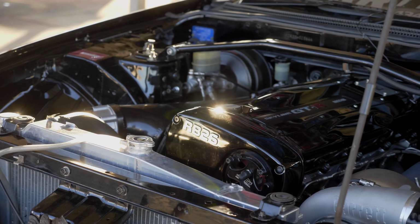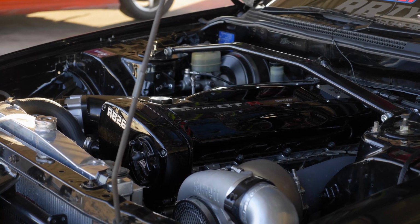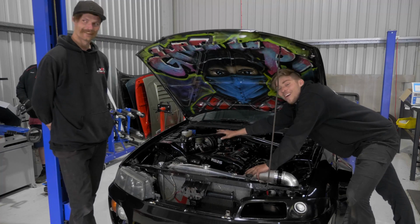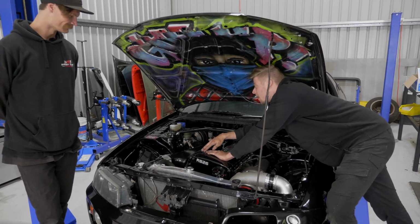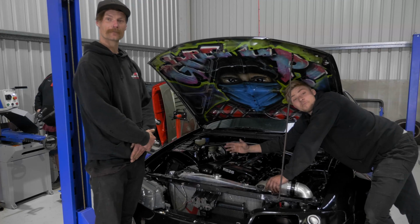So RB28, so this was originally an RB26, obviously. It's got a Nitto stroker kit in it. So being an RB26, it would usually have 6 independent throttle bodies with the Plazmaman intake manifold. That's all done away with. When you buy your manifold, you can specify if you want 6 or 12 injectors, so they have provisions for both, depending on what you want to do. And Plazmaman seems to work quite swimmingly.